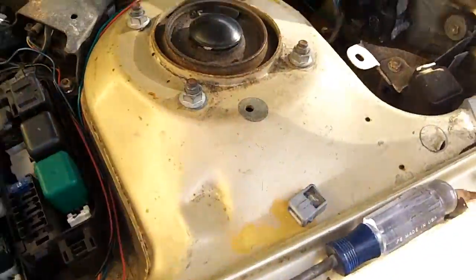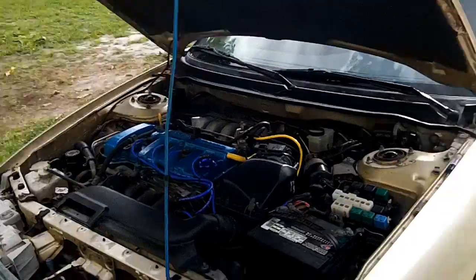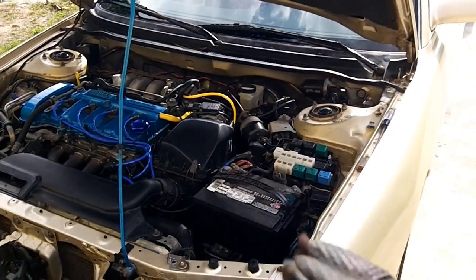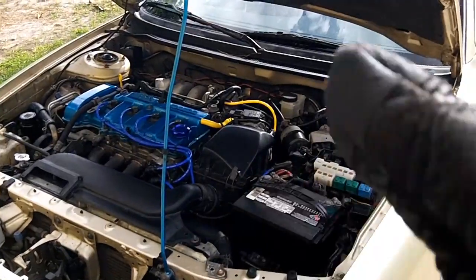When you do that, you're going to notice a fluctuating idle or some weird idle condition — your idle is going to raise up real high or go down low. This fluctuating idle sounds very similar to what I was getting during my gear changes, so we're going to see if lowering this is going to help out.